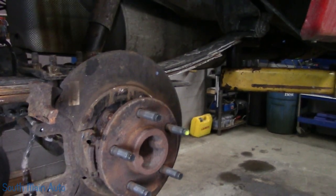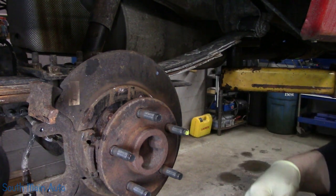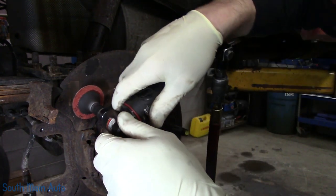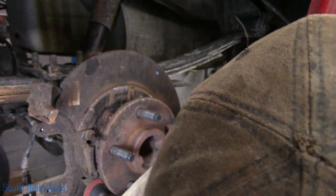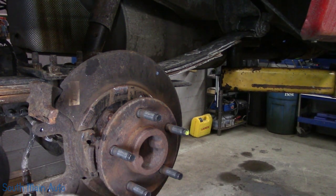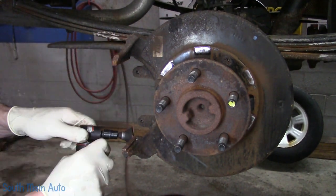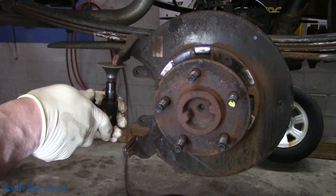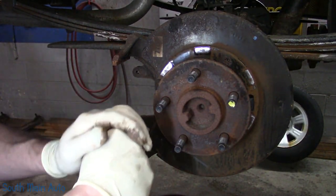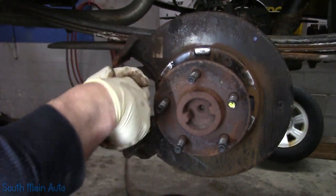Let me get a whizzy wheel here. We'll whizzy wheel the mounting pads — which is this surface right here, here, and here — there's six of them total. We'll shine them up a little bit. I'm also going to take and clean the mounting surface up here for our caliper while I'm right here. Then I'd like to get the inside porch on it just with a stiff wire brush. You can get in here with a little square file too if you want to hit the backside real good.